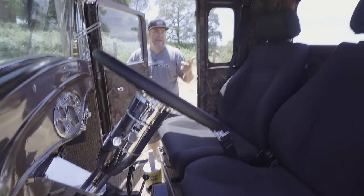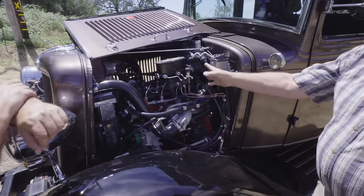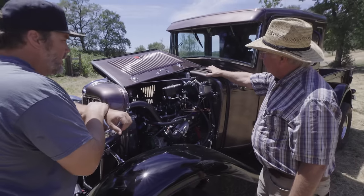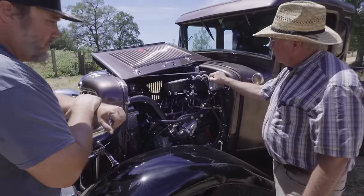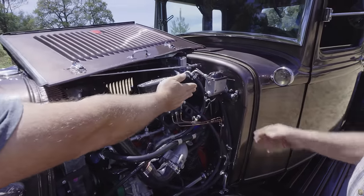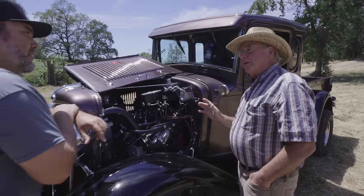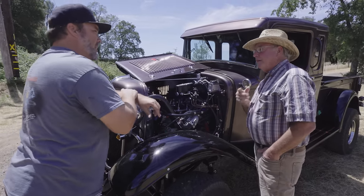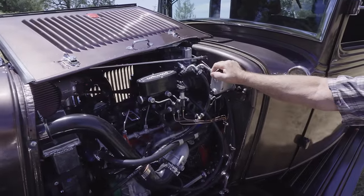With the Cummins, there's a lot of rattle. Let's open the hood and look at that. This is what we were talking about as far as the brakes — you've got a Hydro Boost setup. We're fans of the Hydro Boost; we put them on everything. I had to use a big bore on both the clutch master and the Hydro Boost. With swing pedals, you don't have all the stroke you really need, but with a big bore, a little movement gives you enough to actuate the clutch. And the same on the Hydro Boost — it only moves a little, but you're pushing fluid to the brakes properly.